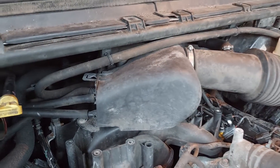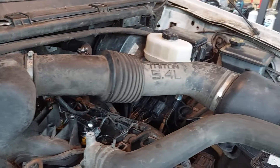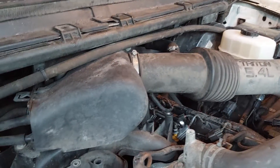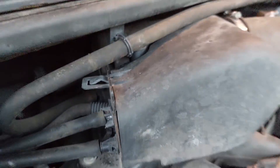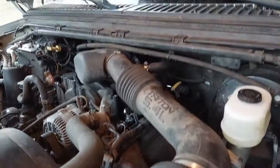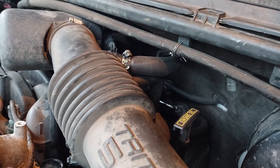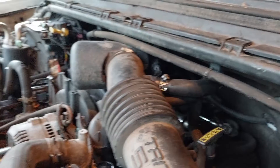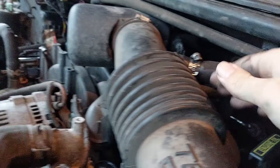I'll give you some reference. That is your throttle body, and there's your air intake tube. So if we want to get at this, you actually want to get at it from the driver's side. You can see it better on the passenger's side, but bolt access is better on the driver. But to get that access, the air intake tube has to come out. In my setup — I know mine's not stock anymore because I've got this used — I've got a clamp here that's got to go, a clamp there that has to go, and then I've just got to pop this line off.